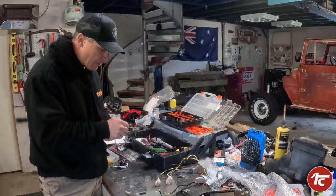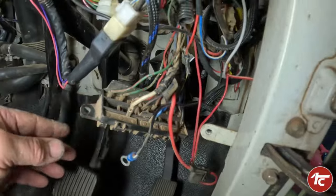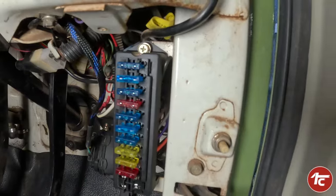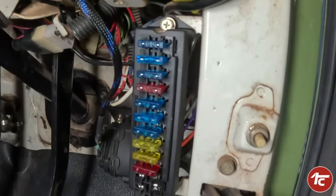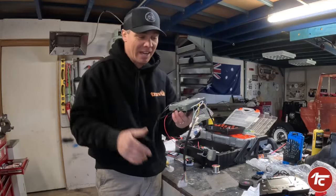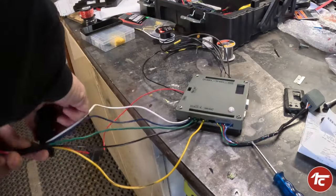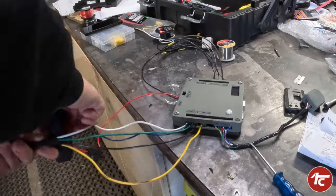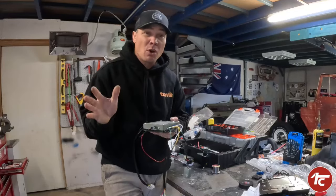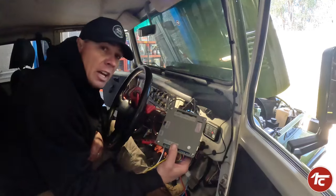We've been on a bit of a wiring frenzy - we've ripped out the old fuse box and rewired the entire fuse box, getting rid of the old glass fuses and putting in blade fuses. That'll just make things a lot easier to get fuses for anywhere down the track - any service station sells them. The glass ones are a little bit trickier to get. Our brains unit is ready to go in the car. I've put an inline fuse in, just five amp. We've taped it up to keep the wires a bit neater, and it's ready to go. You can put it in your glove box, behind your dash, it doesn't matter - you can put it anywhere you like.